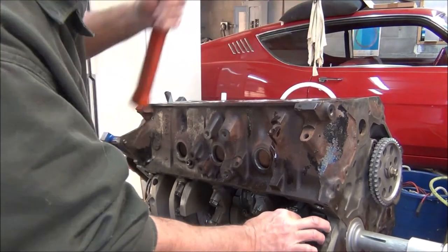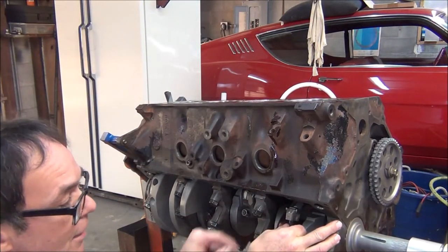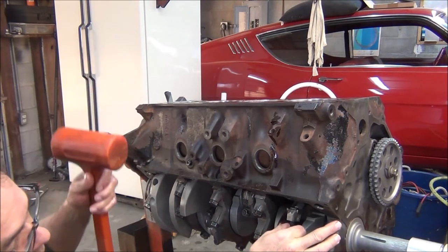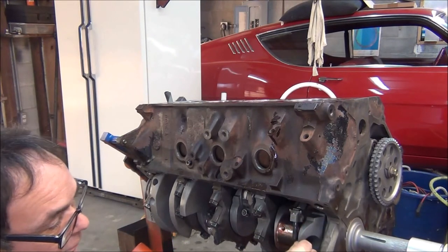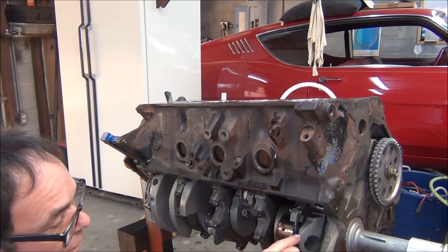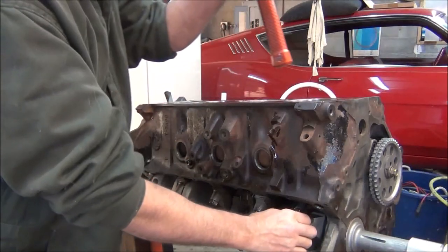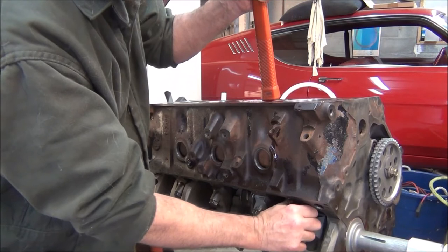You need to be careful when you start tapping it down onto your crank. Make sure it's twisted enough where it's not going to hit this right here, because if it's spun the wrong way, your bearing can kind of catch on a sharp corner and nick a bearing. I've had that happen. Then you've got to pull it back, get that bearing back out and deburr it. I don't want to have to do that — I've already got it lubed.